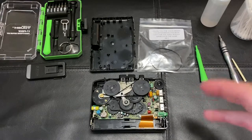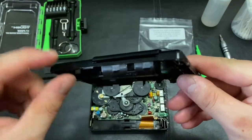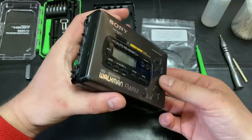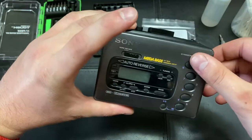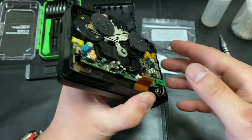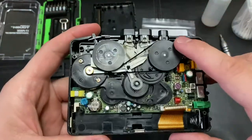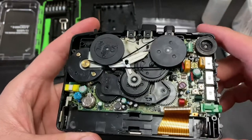I tried combining both units but couldn't even get the back off one of them. With this Sony you just push these two clip spots and the back comes off, but the other one had stuff soldered — there must have been a board in there, it was terrible. I think these Walkmans were mid to late 90s, and these were the best ones because you had Dolby and digital tuners — none of that analog wheel problem. The all-silver newer ones look more toy-like and are cheaper. This one worked when I got it; the belt just got too worn out. So I fixed it and should have a working Walkman.